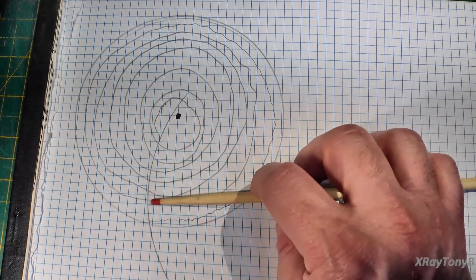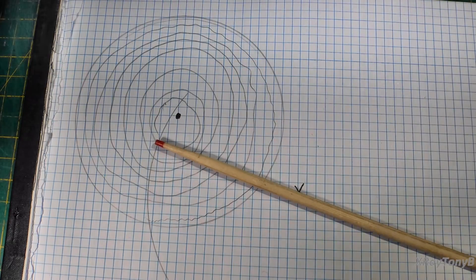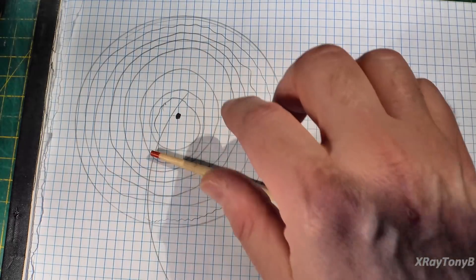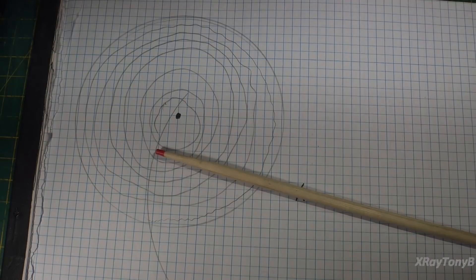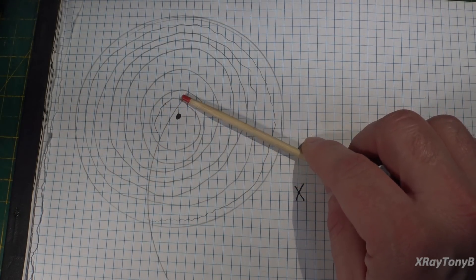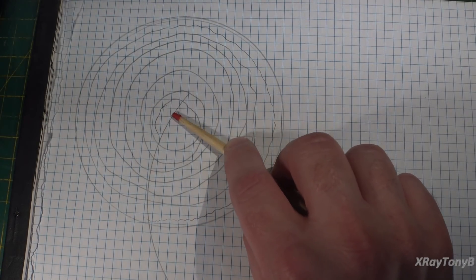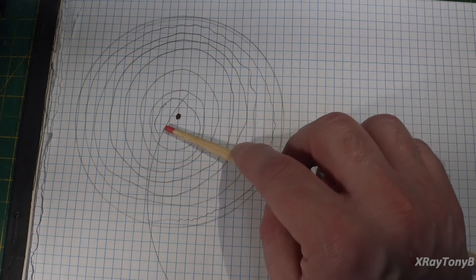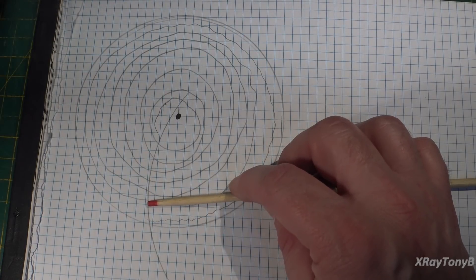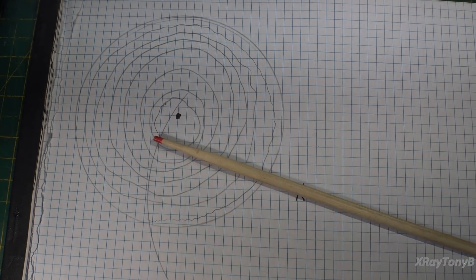The point at which you set these null points - these are called null points - is a topic of discussion and debate. Different null points will give you different performances throughout the course of the record. If you notice in addition, here's the spindle, and my stylus is actually tracking somewhat past the spindle - I'm exaggerating a lot of things so you can see it. The distance from the spindle to the track of your stylus past the spindle is called your overhang. That overhang is important when it comes to establishing those two null points. All these things are taken into account when a turntable is designed and when you set it up.